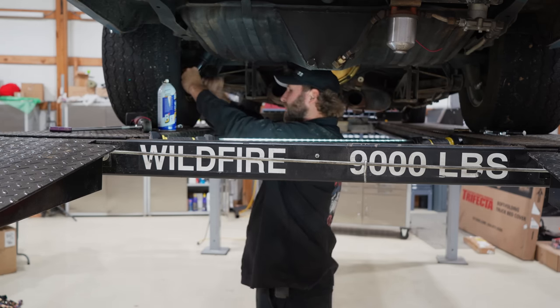Gotta get a vacuum gauge out now, and we're gonna pull vacuum on this, and we're gonna do four corner idling. They do not need to be the same. I hear a lot of people say they have to be exactly the same on your idle mixture screws. Nope, they are whatever it is for the greatest vacuum the engine pulls. And that's the science that's happening in here that we can't see.